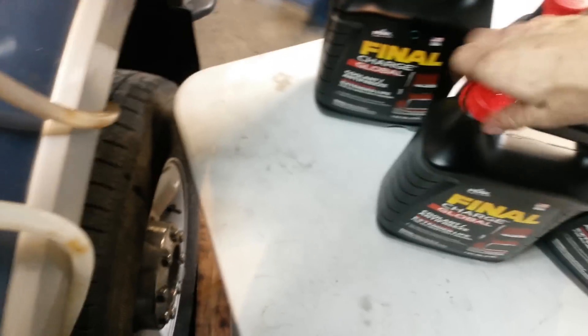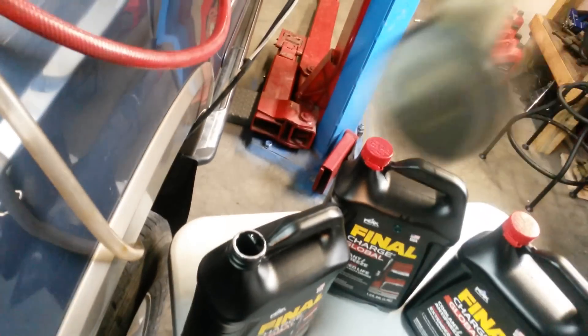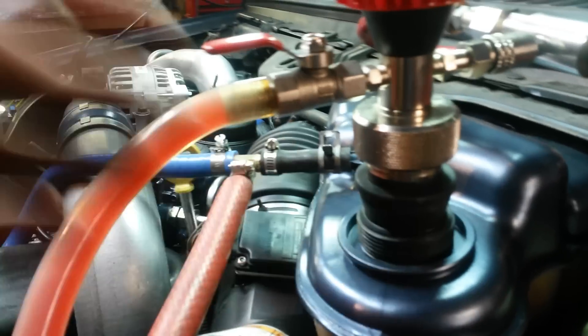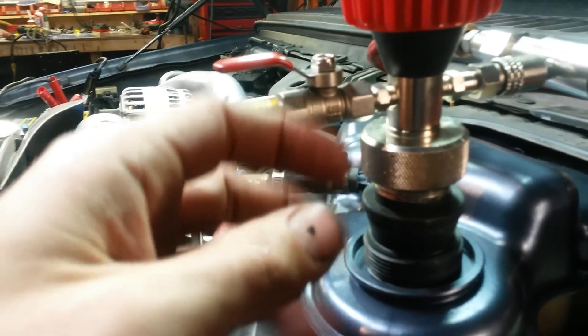After we've watched and made sure we hold vacuum, all we're going to do is open up one of these bottles here. Stick the little nozzle down inside — it's got a weighted screen filter on the end — and we're going to release this valve here. That will suck it straight out of the bottle into the cooling system. At the same time as it's filling, all of the air is being sucked to the top and put under vacuum, so there's lower atmospheric pressure in there — your air is going to be more likely to float to the top and evaporate.